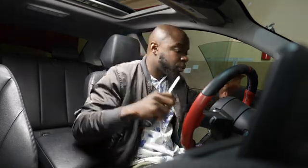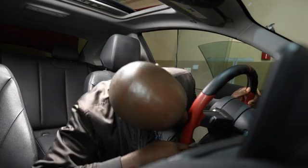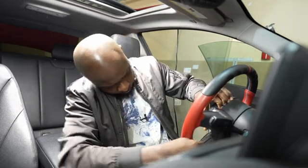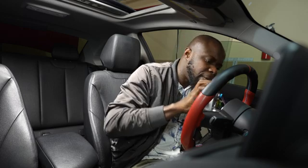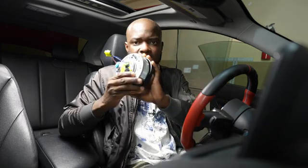To get started, the first thing you have to do is disconnect the battery. Then get a flat screwdriver, find the dots on the side of the steering wheel, and pass the screwdriver through. You have to reach a spring and press it, which will pop and release the airbag. There it is - very easy and simple. Pop and release, then disconnect the cables.